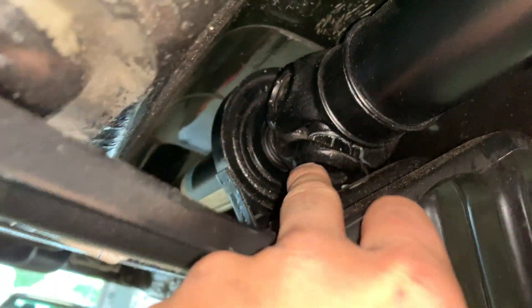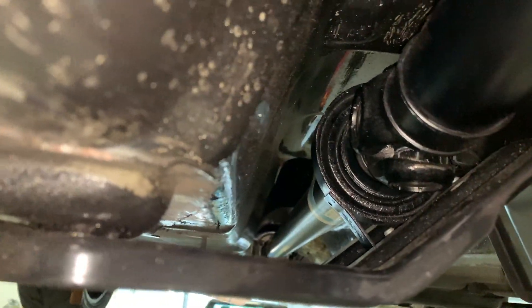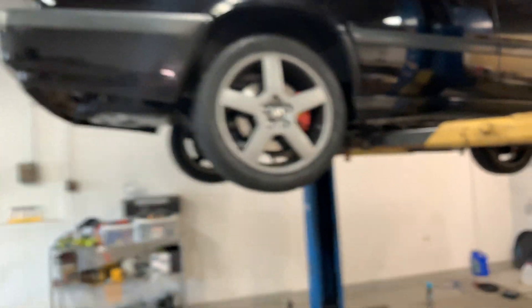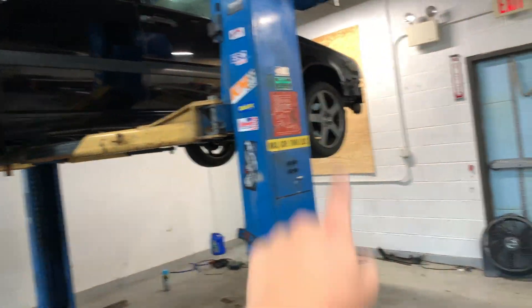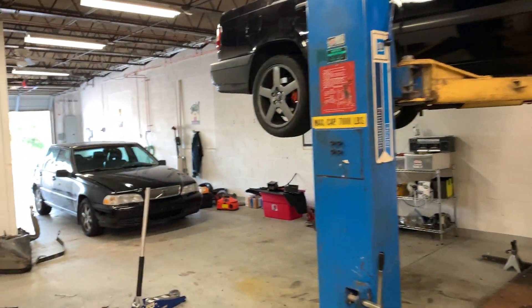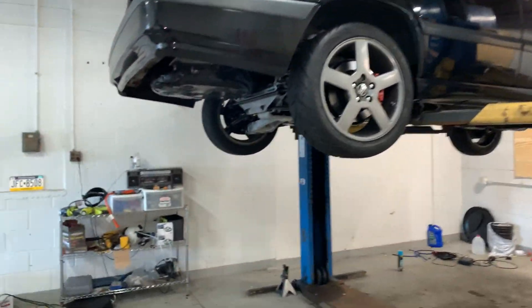Another strange thing I noticed is the u-joint is so close to the carrier plate that it actually makes contact on a launch. You can see it right there — if I pull on this, you can hear the u-joint is actually smacking on that plate inside the carrier. I've got to fix that. Other than that, the rear end is making a lot of clunking and thunking when it gets torque. I'm going to fix the suspension, do another drive, and if that doesn't fix it, I'll pull a front axle — I 3D printed a plug — and run it rear-wheel drive to tune the suspension.